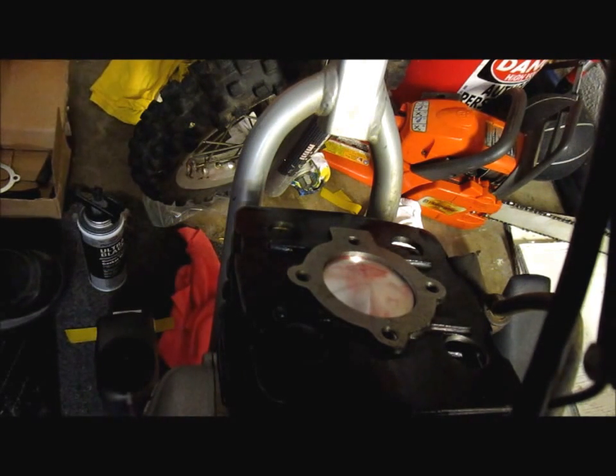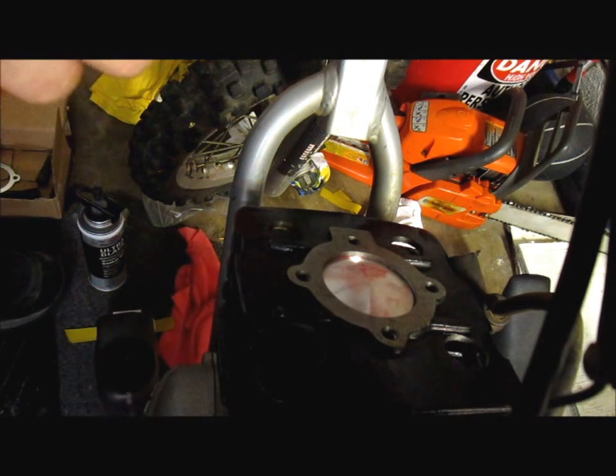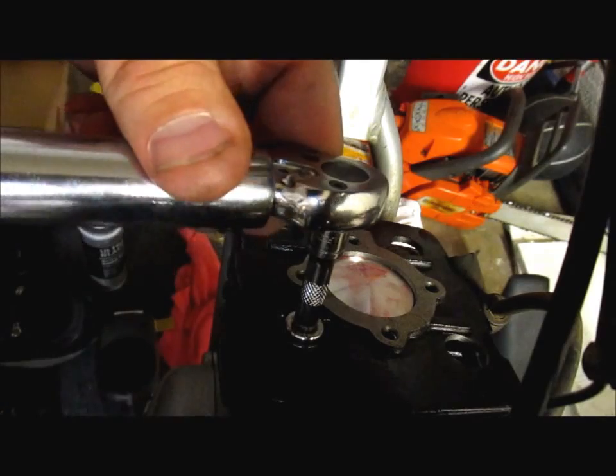that's a 10mm bolt, or I think they call that an M10 bolt. And I think that's roughly about 18 foot-pounds on those styles. So I'm going to set up this old inch-pound reader to about 220 inch-pounds, which is converted to about 18 to 20 foot-pounds. I'm not a real big torque monster, but it's 220 right there. I'll back it down 5 and call it good. But especially on cylinder head, stuff like that, you want to try to be somewhat exact and torque it down. So I would say about 20 foot-pounds would be good.